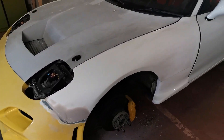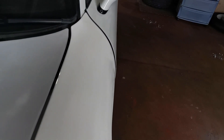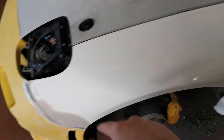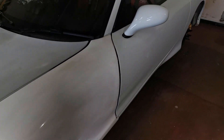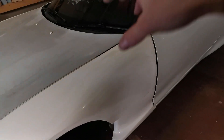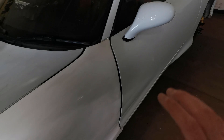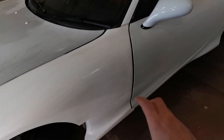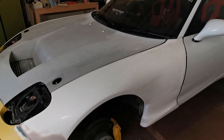Today we're going to focus on the arch to door gap. At the minute the door sticks out a little bit more — I've got two options. I can slap loads of bog on, essentially blend it about ten inches back to make the panel look flat. What I'm going to do instead is take the bumper off — that can stay off for good now — take the wings off, and then play around with the door hinge because I think I've got a little bit of room to push this in. We'll get the door in as much as we can without it looking daft on the sill, and hopefully it lines up. If not, it might be only half a mil out — we'll give it a little skim to get it nice and flat.